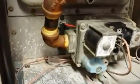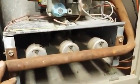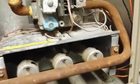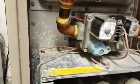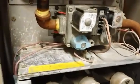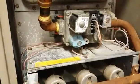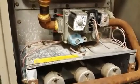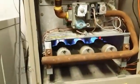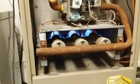I've reinstalled the switch, put it back, and reconnected it. I did clean out the contacts using some sandpaper. I've also reinstalled the gas burner section that I had to remove in order to get the switch out, reconnected all the connections, and I'm now ready to plug in the electrical and see whether it works.